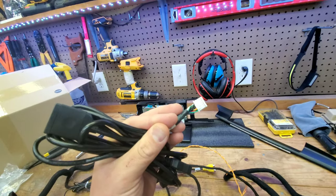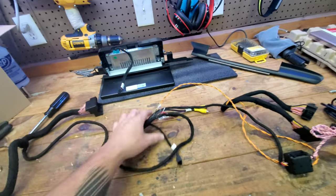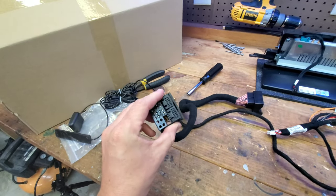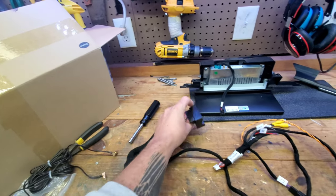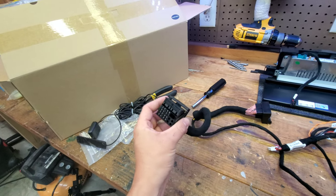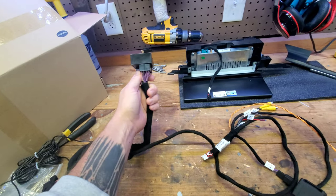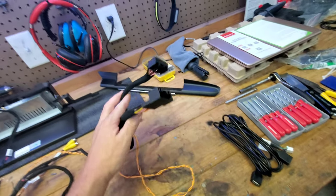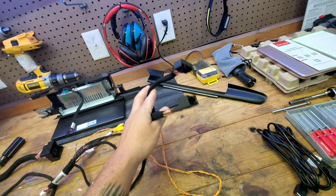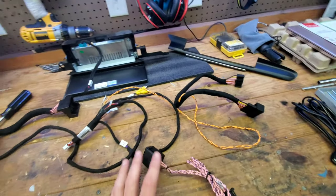This little piece will plug into the unit. Then we have this big wiring harness. These are called quadlocks — large four-sided connectors. This piece goes into our OEM harness that connects into the back of the OEM CD player. This piece here is the HVAC bypass — one end connects to the OEM wiring harness, the other connects into the back of your HVAC panel unit.